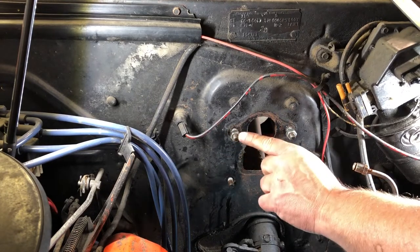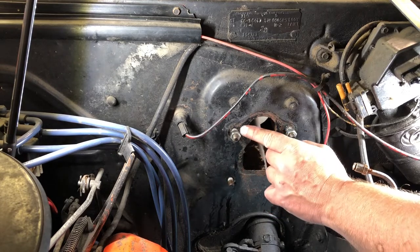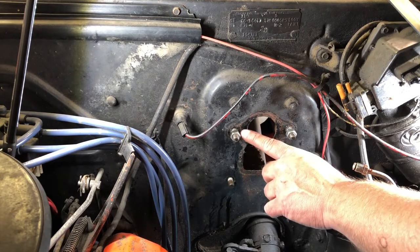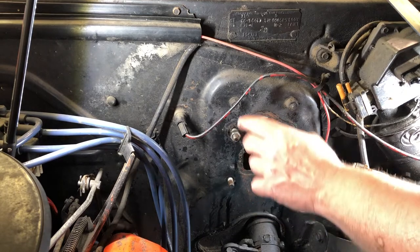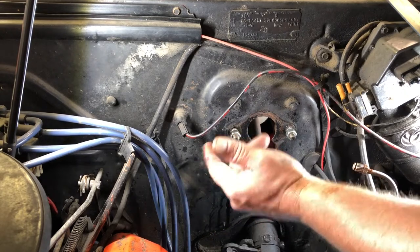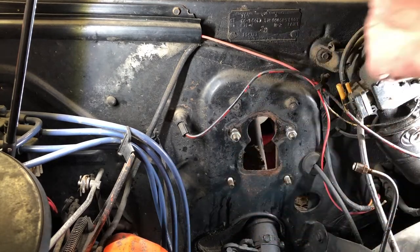If I run my cutoff wheel right flush with the head of this nut and the nut doesn't move, or if I get a line going before that nut moves, I'll be able to shear off that much of the stud. Having the nut on there is actually double duty. It'll clean the last thread that I booger up with the wheel, so I can just twist it off, boom, it'll be clean. We'll check it a couple times, hit it with a file if we need to, which I highly doubt, and then we'll try this again for like the 50th time.